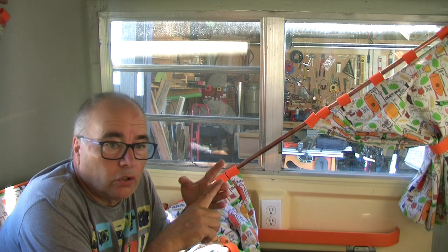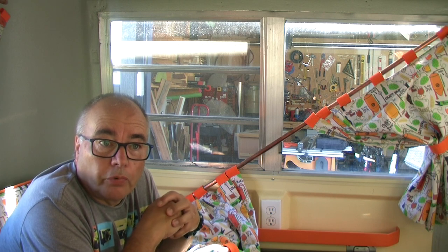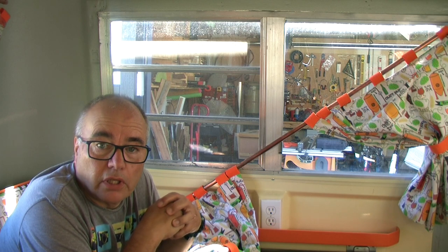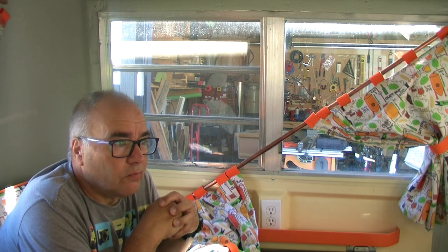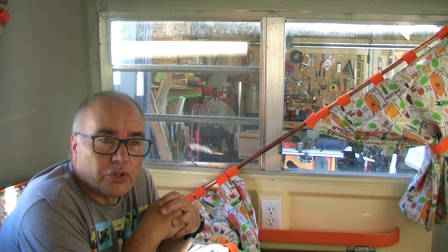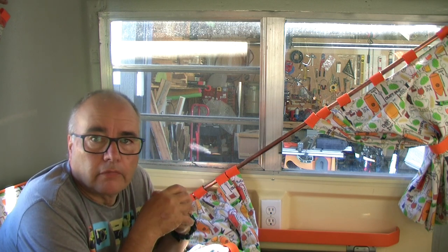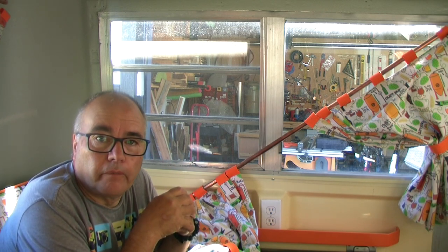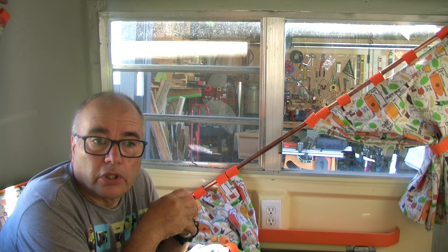Because molded fiberglass trailers like this are essentially manufactured from one, or let's say two, pieces of molded fiberglass, a top and a bottom, the only leakage potential in these trailers is basically around windows, the belly band, or grates and screens that open to the outside, like the back of the refrigerator vents and things like that. So one of the first things you should do when you get a new old fiberglass RV is check the windows for leakage.